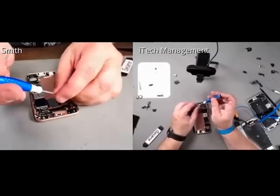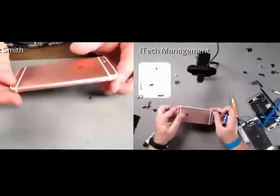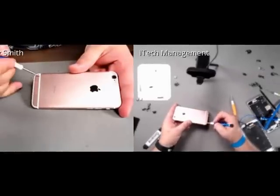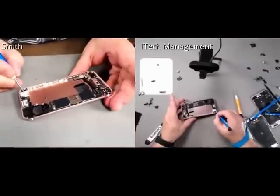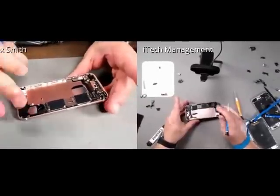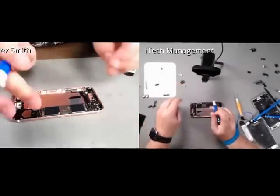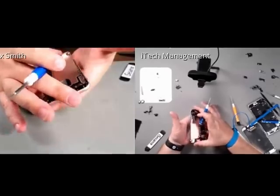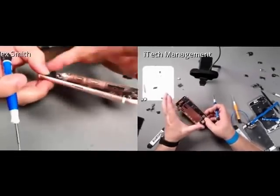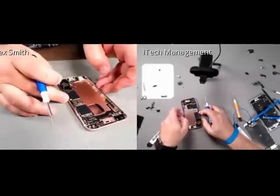So, I don't know if many people understand how the signaling works in the frame, and see how you have the separators on the back, and then around all these corners here you have what's called an inductive coil, which literally transfers signal. When you grip it, it'll transfer it to the other edge of the frame, so that you keep the same intensity of antenna strength.